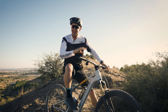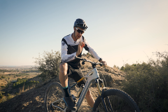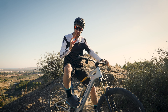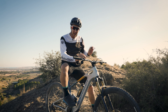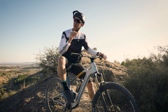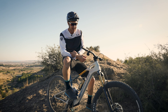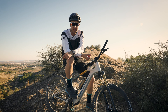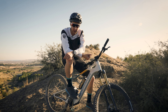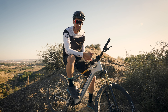That's not bad for pretty much base settings. I took a little bit of air out of the front fork as it was just a little harsh for me, and I adjusted the low speed compression. I'm pretty happy with that for good base settings — running a touch over 20% on the front and 35% on the rear, bang on for me. It's important to get to the base settings and then work from there, otherwise you have nothing to work from. Hopefully this video has been helpful. If you've got any questions about setting up your sag, let us know in the comments. We'll do something with coil shocks at a later date, so make sure you subscribe to the channel. Thanks for watching — see you soon.